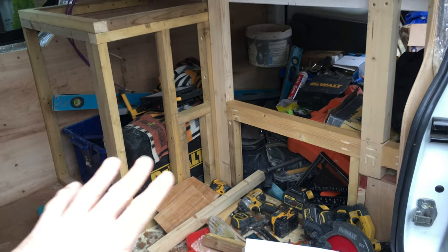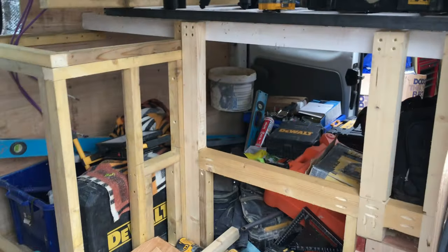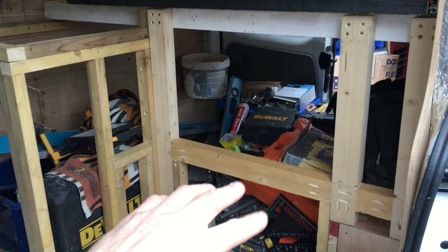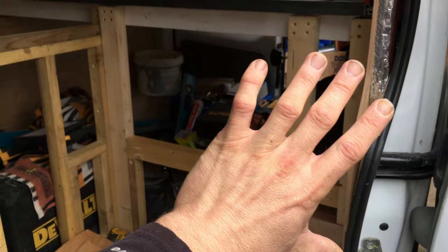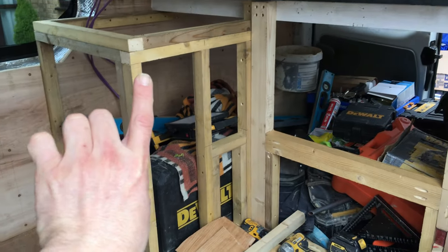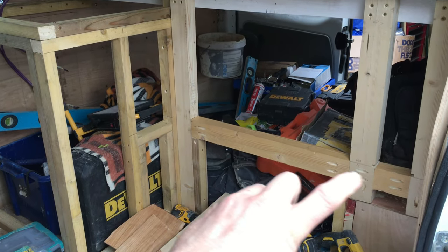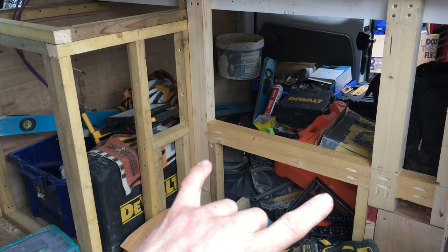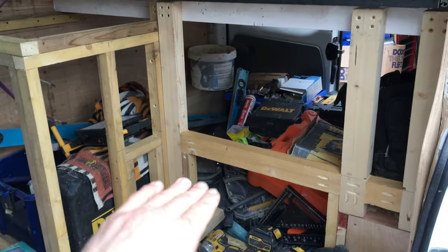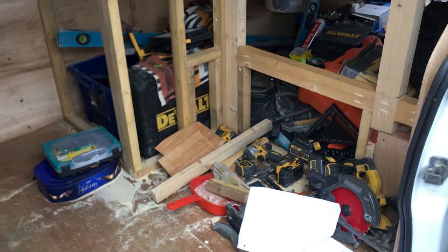And because of that folding back up, I need to have some sort of supporting wall. Now, I had to play around with this quite a lot, change the ideas a fair bit, whether it was hinges sitting on this timber here or what. So the plan now is to have cladding coming across, so we have timbers to pick up that cladding and then return in on here. And then on top of that cladding, you're going to have a platform here, which will have hinges in order for the bench to pivot back up. I'm hoping that we can have a bit of padding at the back, and then padding on the seat, and as it folds up, the foam itself sits inside, and then that's out the way. That gives us a bit of room within the kitchen area.